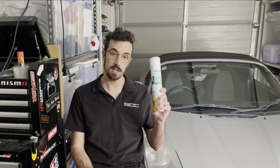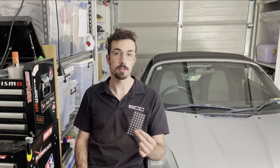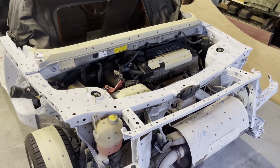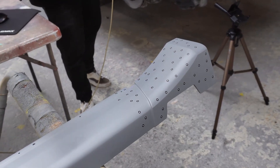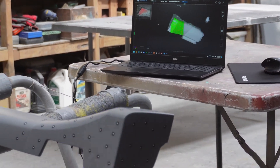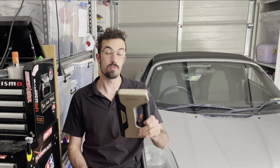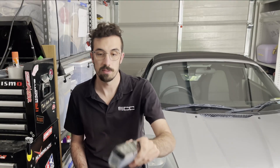As you'll see in the video, I did something a little different but along the same thought pattern. These scanning dots are primarily used for tracking so that the 3D scanner doesn't lose what it's looking at or where it is in space. The more of these you have, the better — it needs to see at least three, but preferably more at any one time within its scanning window. If you watch Chris's video of me scanning the Stagia widebody, you'll see we absolutely covered the car with these. That was a lot of extra work and didn't really get any benefit, so we now know using the Einstar is the way forwards.